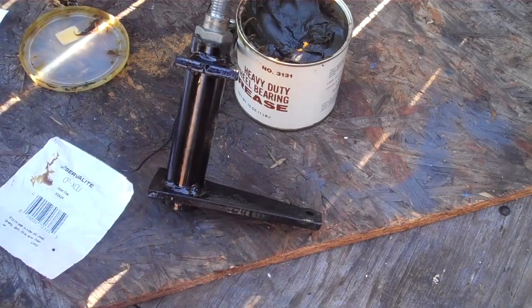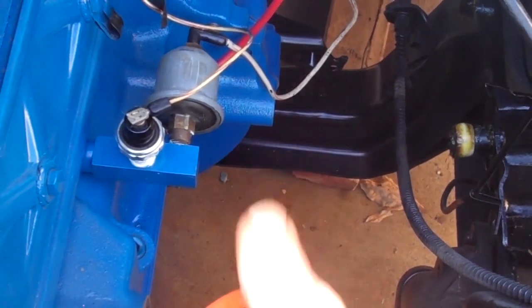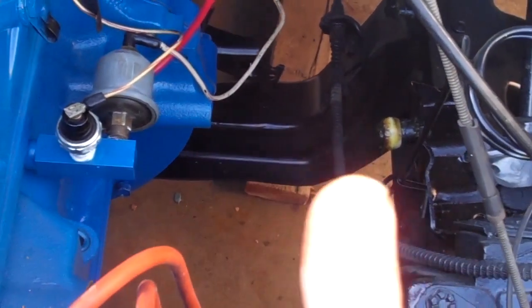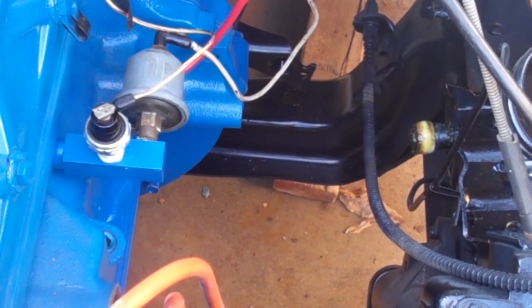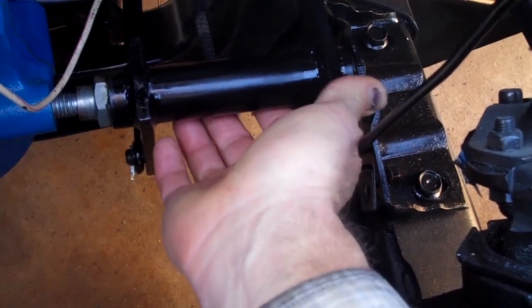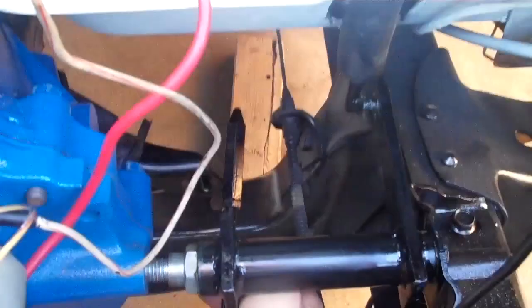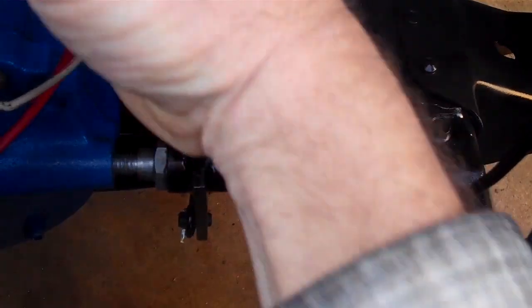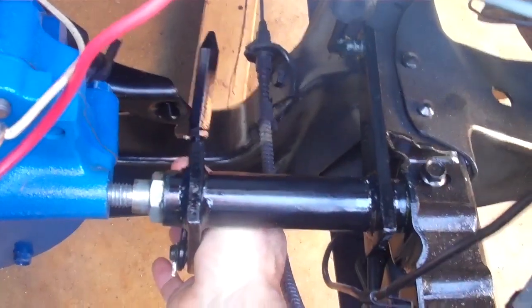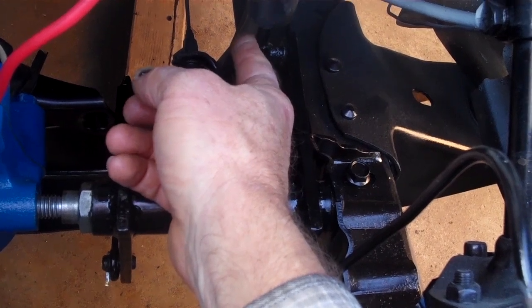I'm going to go install that now. You can see where it's going to go. There is the bushing for the equalizer bar bracket — it's going to attach right over here on the other end, right there to the engine block. You can see right down over here, that's where the clutch rod is. Everything is in place here — there's the equalizer bar running from the equalizer bar bracket over here to the block, and there's the rod that connects the equalizer bar to the clutch release lever right down there. That's where the clutch rod comes down from the clutch pedal to the equalizer bar — the clutch pedal to equalizer bar rod.